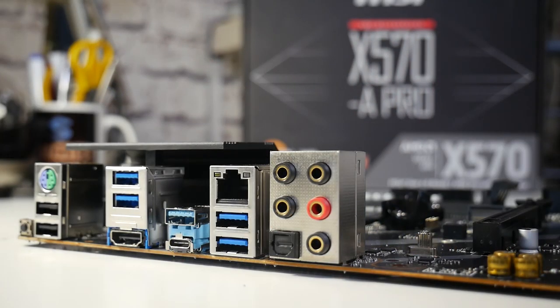So that is the MSI X570-A Pro. Honestly, I'm really impressed with it for the price — it offers fantastic value for money. Yes, the VRMs are not the best, and they possibly are the worst of the X570 chipsets. But realistically, if you're using a Ryzen 5 or even a moderate Ryzen 7, you've got no issues whatsoever. As you get into Ryzen 9 territory, you should consider a higher-end board, especially for hardcore overclocking. Most Ryzen 3000 series chips don't overclock much beyond Precision Boost anyway, so unless you know how to squeeze all that performance out, do you really need those higher-end boards?